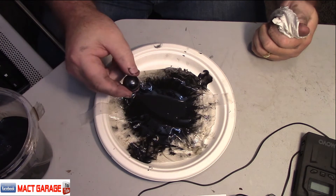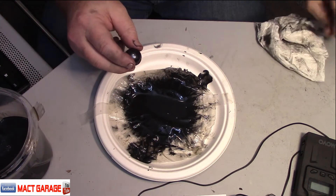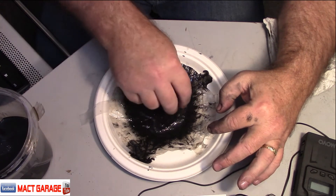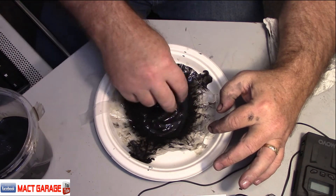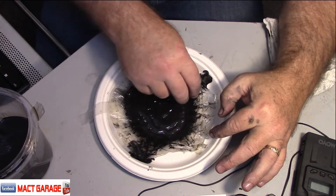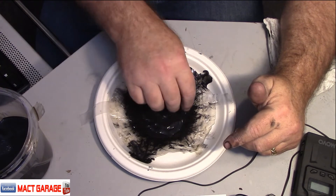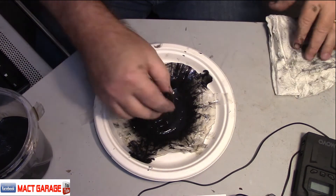I filtered everything through here — there was a small catastrophe on some of the gear lube — but we're just going to roll this through. Then I'm going to try to get the oil off and see what we've got. Now keep in mind this is all the bottom of the barrel, so to speak. In this gear lube I'm rolling around, the magnet should grab hold of everything. Of course, we've got our ferrous and non-ferrous metals — what's going to stick to the magnet will be the irons. The aluminums won't stick, so if there's aluminum in here we won't necessarily know. But I'm not seeing a lot on here.